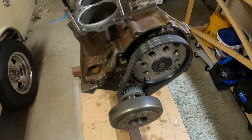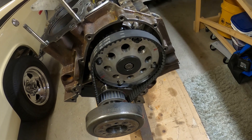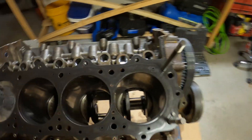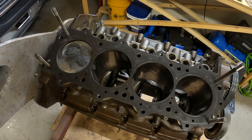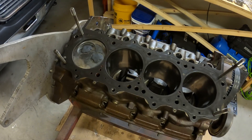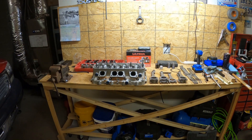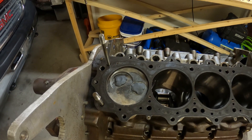We just got the belt drive on — that was a bit of a learning experience, pretty similar to a timing chain but just a little different. Now we've got our number eight hole with a piston in it. I was going to do number one but the bearing clearance was so noticeably loose you could move the piston up and down in the bore even with the bearing in, so that wouldn't give a good measurement. Fortunately number eight has the same valve pocket layout as number one, and that's the cylinder I have the valves disassembled on.